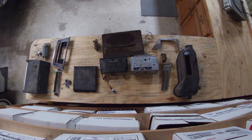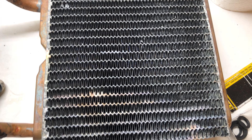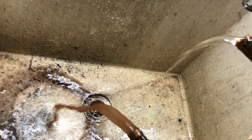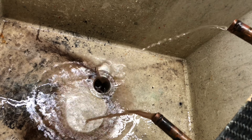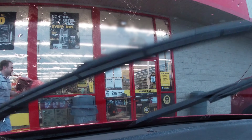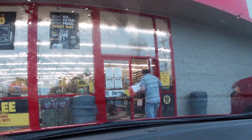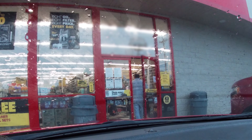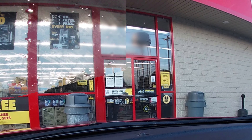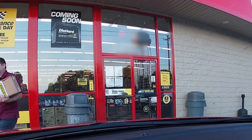We've finally made it down to the actual heater core that can be removed for replacement. Here are the rest of the parts that came out of the car. There are a couple of problem spots evident now that we can see the actual core. Even with the coolant filter, this heater core still harbored rust, which you can see once I ran some water through it. I'm really big on keeping track of warranties, and when I purchased this it had a lifetime one. I packed it up, grabbed my receipt, and headed to the auto parts store. In less than a week, I walked out with a brand new one for zero dollars.